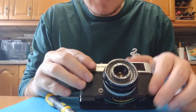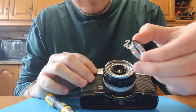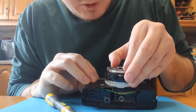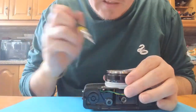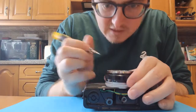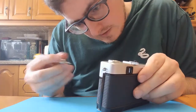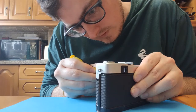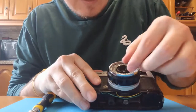The good news is you can actually get to them — they're not as tight as I thought. Just unscrew them a little bit but make sure they don't come out completely or you'll have a massive pain on your hands. Be careful because this is dealing with the focus ring — you want to make sure it goes back into the same position. I'm going to put a little mark on the inside at 12 o'clock so I can put it back the same, otherwise you'll end up with a focus issue.